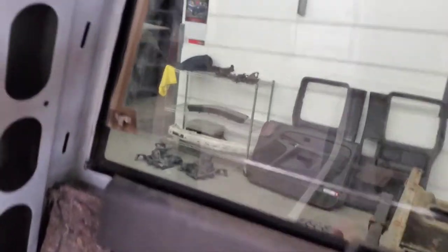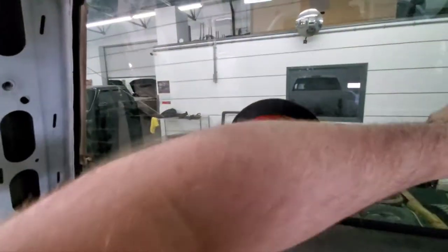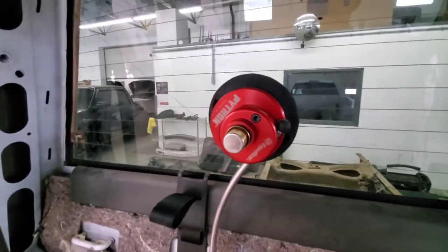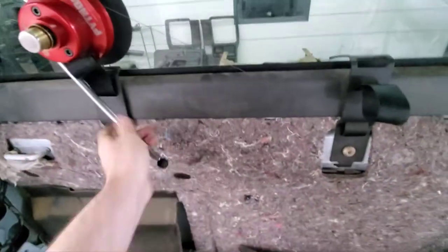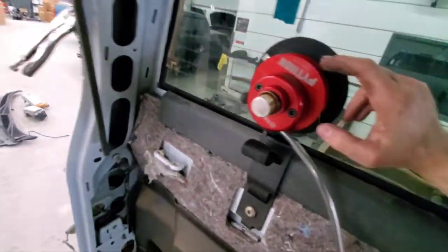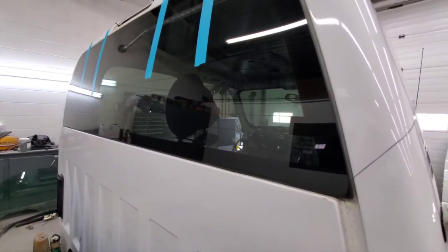Try not to cut stuff you don't want. You just give her. And if you get to a tough spot, you can kind of saw at it until it comes loose. If you're doing it by yourself, put some tape so that when you cut it all the way out, the glass just doesn't fall and break. You can literally just crank it around and it's super easy. You don't have to worry about damaging the paint. There's a little board you can use to protect your dash or any garnish moldings. That's the beauty of this thing — you do not damage the paint. Because it cuts — it's like squeezing it and cutting it. Best thing in the world. I would never cut another piece of glass without this because it saves the paint.